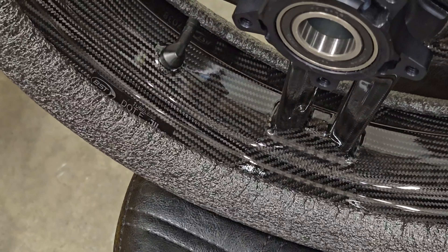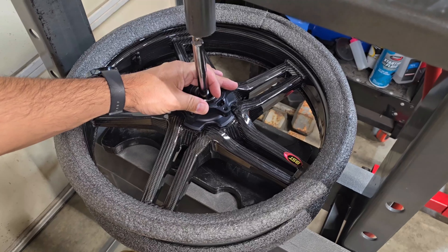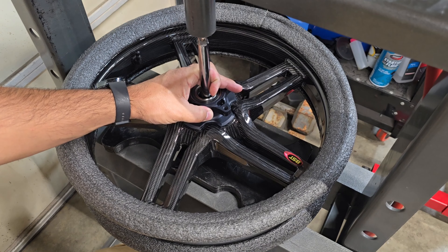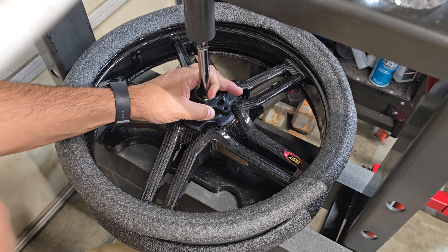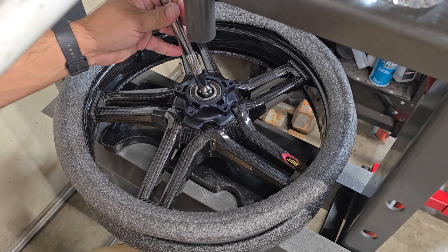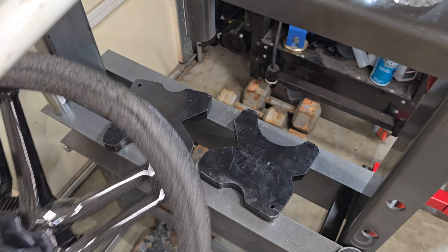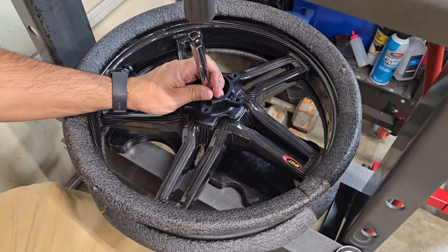I have a press so I press them out, but if you're limited on tools, just use a long shaft extension on your sockets — like I'm doing here — or even a flathead screwdriver, anything really. If you're not trying to reuse these bearings, don't worry about damaging them, but definitely be mindful of your rims. What I've got going on here is a socket extension catching the inner lip of the race on the other bearing and pressing it out. I'll speed this up and catch back up afterwards.